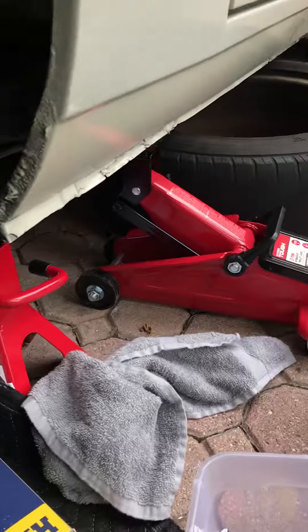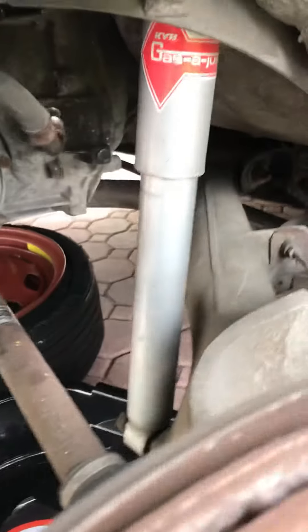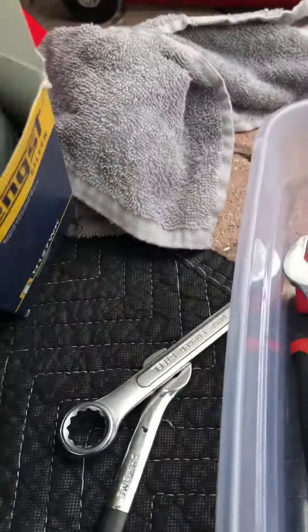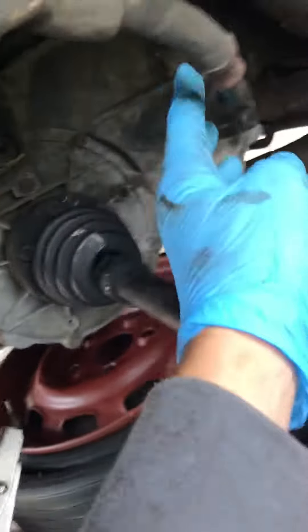This is Tim Chargahasse Brothers Porsche repair. This is a 1987 924S — I'm changing the fuel filter. The filter looks a bit like this. I put the date on so you know when it was done. Make sure you get the direction right. You've got a hose coming in, the fuel pump is right here — a Bosch fuel pump — and you've got a line going right here.